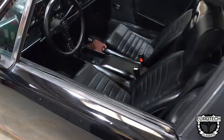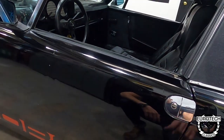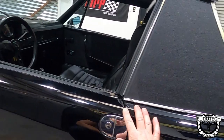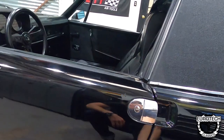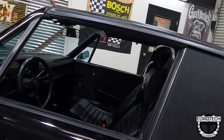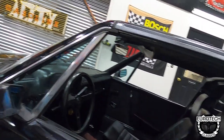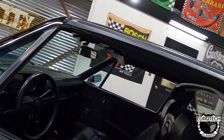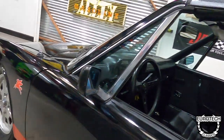You can also tell by how the doors open and close — if the gap is pretty normal, you should be fine. When the top is on and these are almost touching, that's a good indication that there is rust in that hellhole area and in the longs, actually causing the car to flex. Since this has a fiberglass Targa top, there's not a lot of roof rigidity. I've had 914s where you pull the top off and then you can't open the door, or put the vehicle on the lift and it almost wants to break in half.